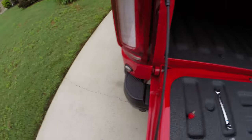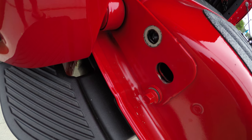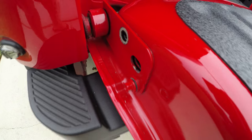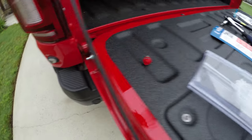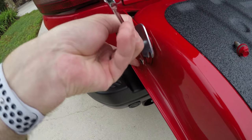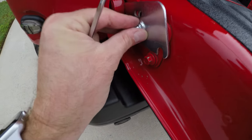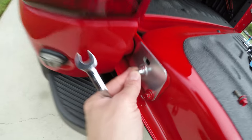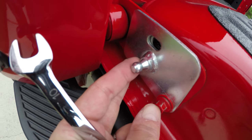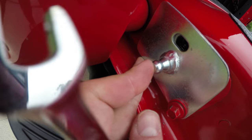Step one — and they stress this in the instructions — remove the top bolt, but just loosen and do not remove the bottom bolt. What happens is this bracket is going to slide in here: the notch is actually going to go right in between there. You're going to have that notch slid behind the first bolt, the hole right there where you'll reattach the bolt, and the actual prong to connect the shock.